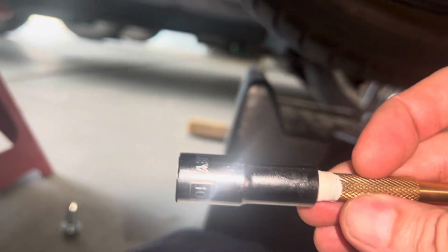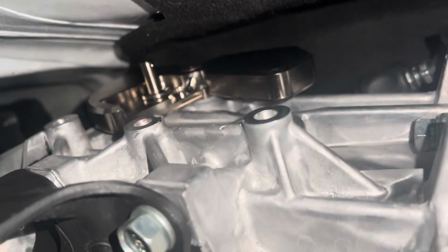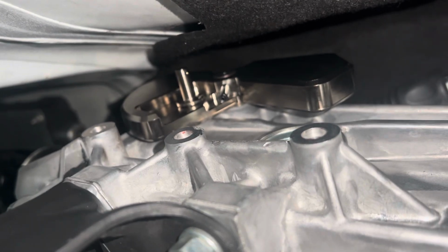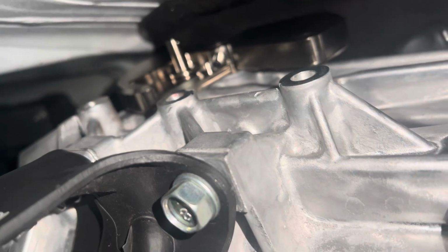We'll see. I've got a brass punch back in the 10 mil socket, a little Teflon tape to hold it stable. And we'll just see if we can get her to go in. I figure the brass punch is nice because I can run it right up flush. Won't hurt anything. So we'll see if that little trick helps keep it a little closer where it should be. Hopefully that chamfer on the end of the roll pin will guide it in and we'll be good. We'll see.